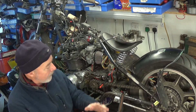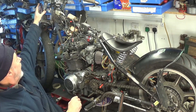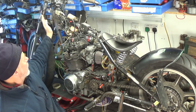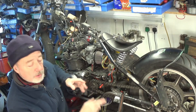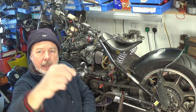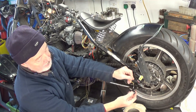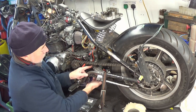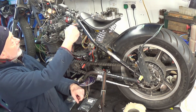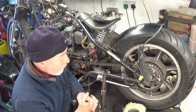It's mainly the back end I'm concerned about. The front end all the wiring is just going to be on a harness and a headlight, so nothing on there concerns the frame. I'm trying to hide all the wires as much as I can. Starting at the back, we've got the little indicators which go underneath here — I've got nuts welded in the bottom — so I'm going to take the wires along here and drill a hole to take them out at the bottom, then up the main spine and out somewhere.